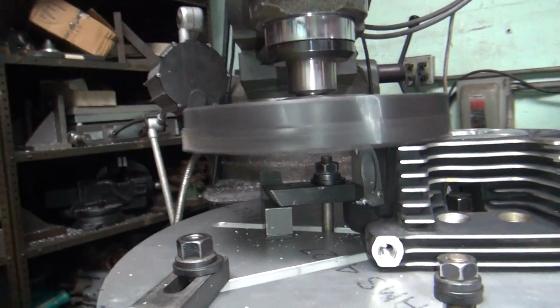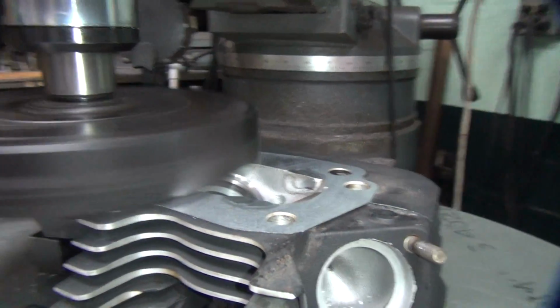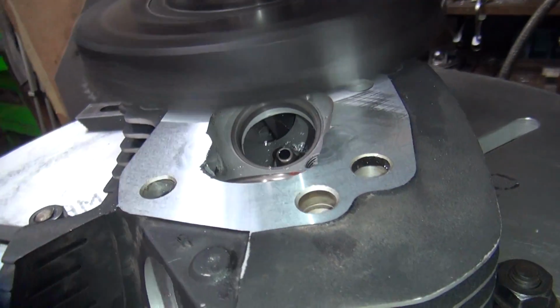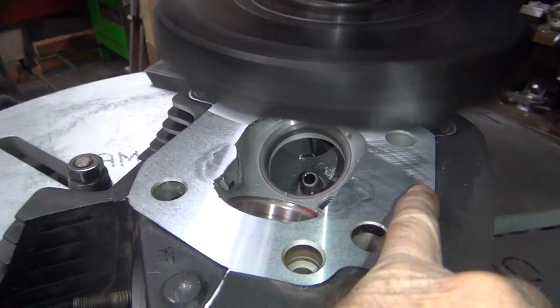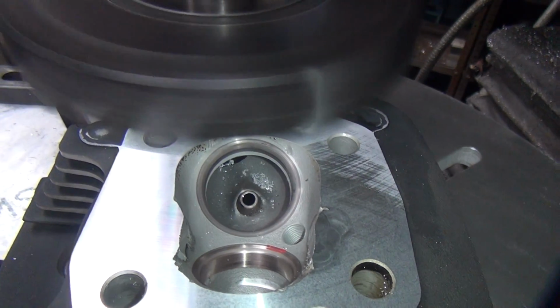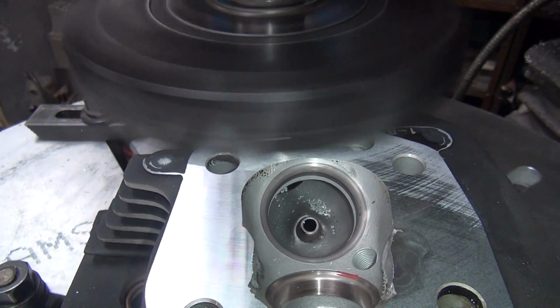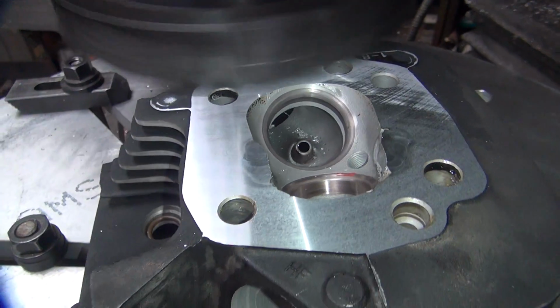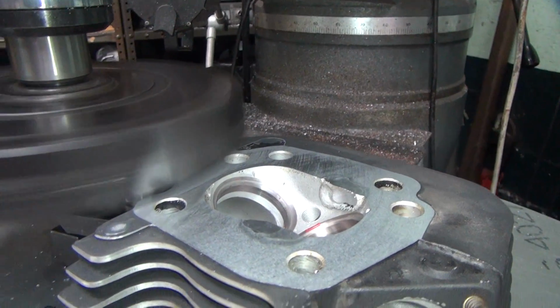Look at the shininess in the cutter now. You see the reflection in the light now. Oh, we're picking up the crosshatch right there, and you want to see too. That's your witness mark saying it cuts correctly. That tells me our mill is straight. I guess I didn't already know that. So that's what a sharp cutter does.